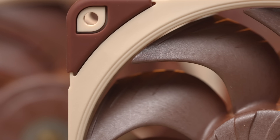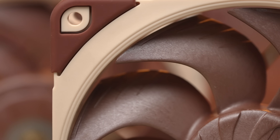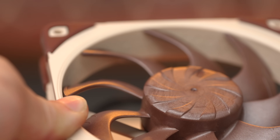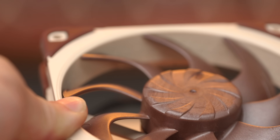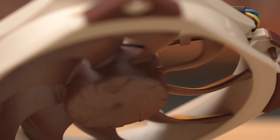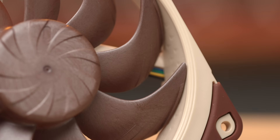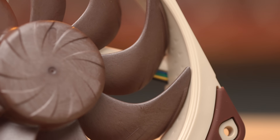The tips do still feature that super tight 0.5mm clearance — that's not changed. A neat detail is that the blade's cross-sectional profile has been fine-tuned for aerodynamics and generates maximum lift or air pressure. If you look closely at the outer edge, there's a thicker section — a little winglet, a wingtip — that helps improve efficiency further.